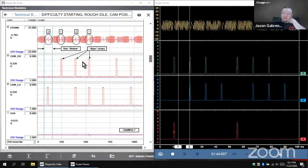If you wanted to do, say, a functional test over here, you could do that. Watch the scope results at the same time. Do functional test, data stream, see how that's going over there as well. So pretty useful to be able to see that side by side and being able to set up the scope in that way where we can have all the channels separated so we can actually see what's going on.